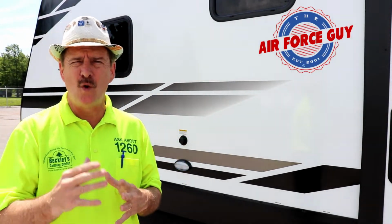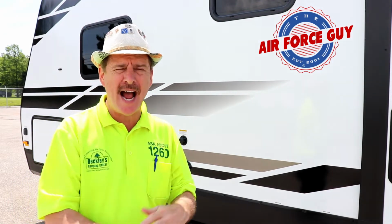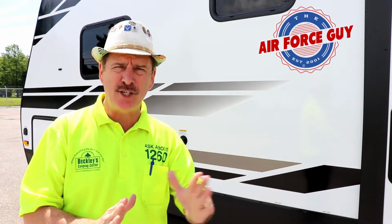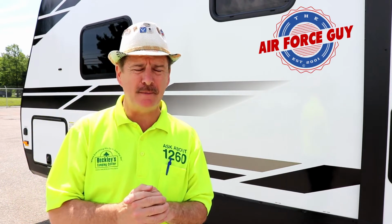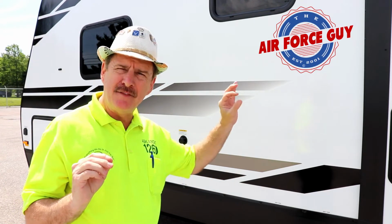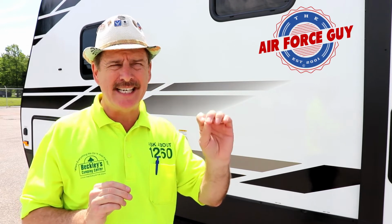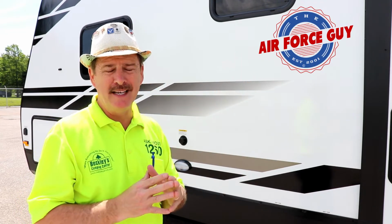Now I mentioned that you must stay on task, although I didn't tell you what would happen if you didn't. Here's what would transpire if you do not stay on task and you get sidetracked doing something else. You've got one of two bad things that are going to happen. The first bad thing is, once the black tank is full, if the seal on your toilet is not sealed properly, it's going to back up into your camper. That's a bad thing. You don't want that happening, do you?